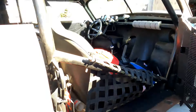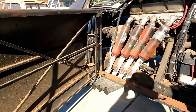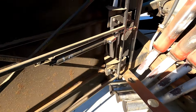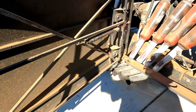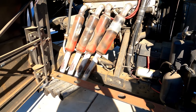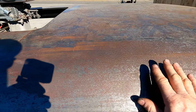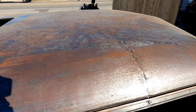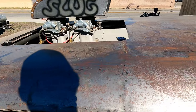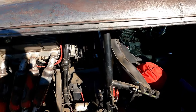The back doors are suicide style. I've got screen door cylinders on them so they lock — right now they're full of dirt so they're not locking. You can see how dirty this thing got from the last trip. For the patina, I've used several products that claim to be wipe-on clear coat sealers, but none of that stuff works. The only thing that's actually going to work is a real automotive clear coat with a hardener, so I'm going to clean this all up and actually spray it properly.